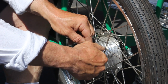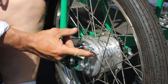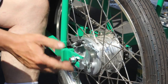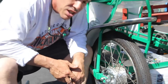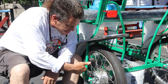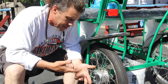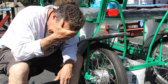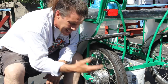This thing is brand spanking new. I don't have anything more left on this nut, and it's going to work to adjust to the stop — but I've got nothing. The cable stretches out, it seats in its own little spots, and I'm not going to have any adjustment. The brake is going to be trouble, brand new. I'm going to have to take off the chain and everything.